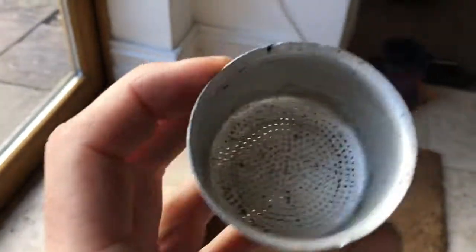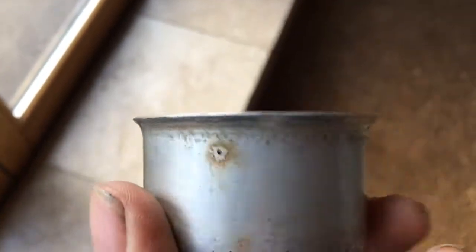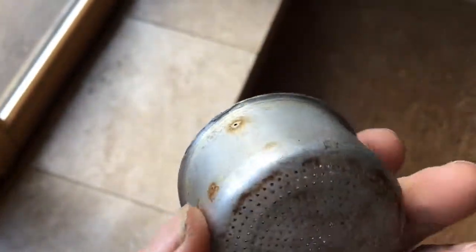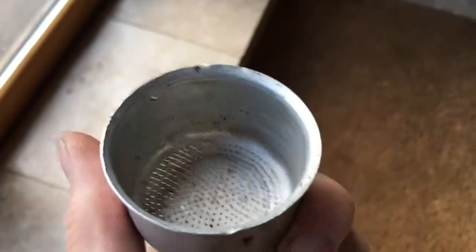We're trying the machine now with a different coffee basket, but looking at it I actually think this is a replica — it's not a genuine Atomic coffee basket. For starters it's curved, and secondly the lip is not flat but almost curved up, which is possibly why it dented so easily. I suspect this is not a genuine Atomic coffee basket and that is one of the reasons this machine has been having problems. You can get genuine coffee baskets from Bond Trading in Oxford Street, Sydney, Australia.